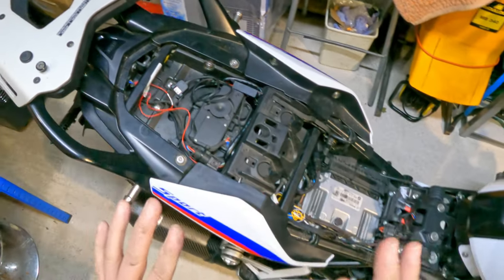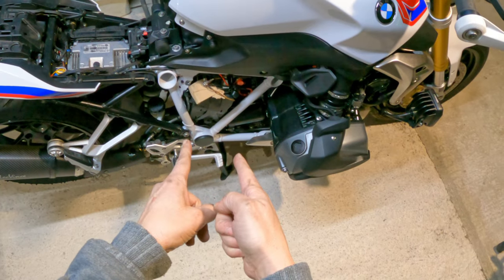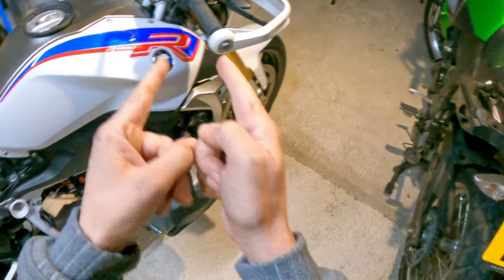Now the Posi-Tap - we have this gray end which the blue cable sits into, and the pointy end which screws onto the blue cable and pierces the sheath. For European bikes, this brown cable is the one I need to tap into, whereas on North American bikes it's a different color. I push the red cable from the relay into the gap, then screw the cap on top for a nice tight positive connection. I'm leaving it all full length for now as I might need to take this apart and replace some cables.